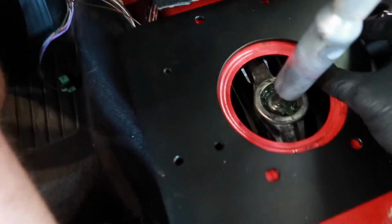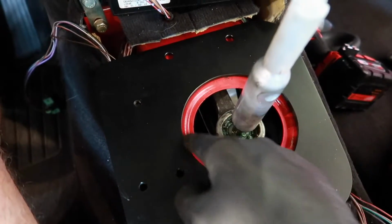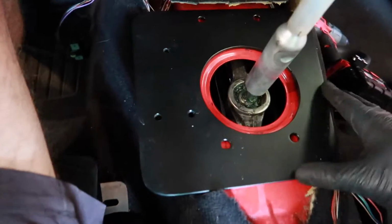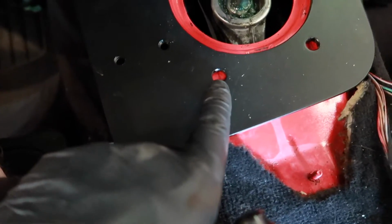So knowing that, I centered my hole here. This is kind of my reference. If I have an even gap around here, everything should line up, and then just keep everything parallel. That way and that way it's all straight, leveled. What I did is I already center punched my holes off camera, these 4.